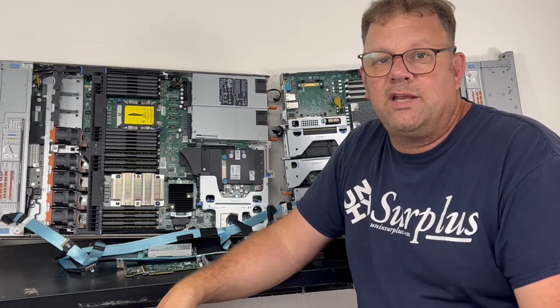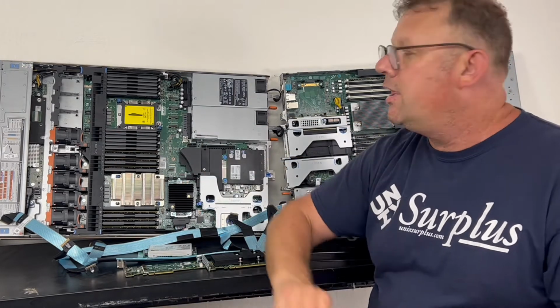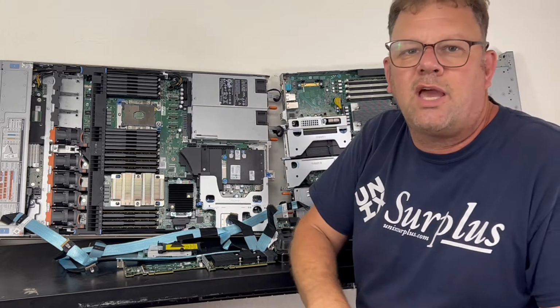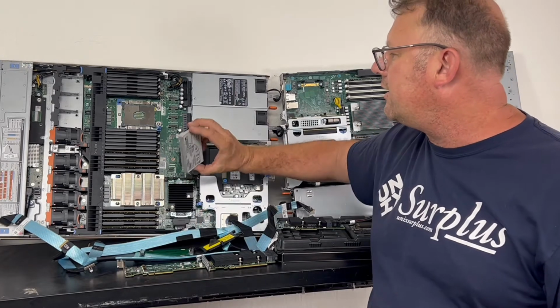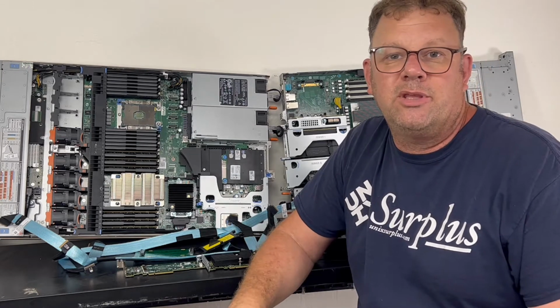However, what we're finding now is that all this stuff into the PCIe buses is too slow. And all these chips right here have so many pins, and all these pins here are just PCIe buses. So the natural thing is to take your SSD drives right here and attach them directly to the PCIe bus. That's what came out and was called NVMe.